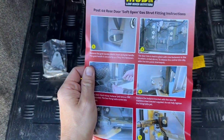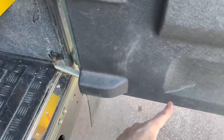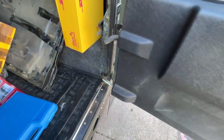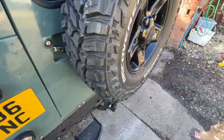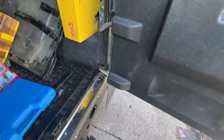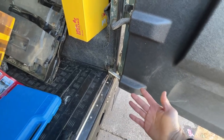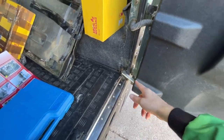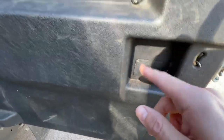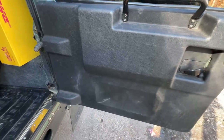The first job is to take the door card off and have that all exposed so you can see where the other end of the gas strut goes. On a Defender, the door swings open on its own accord — you can easily get things trapped when you shut the door, and they kind of swing open and keep going without any stopping. To take the door card off, you've got to take this little plate out here, take these little screws out, and then just get a trim removal tool and pop it all off.